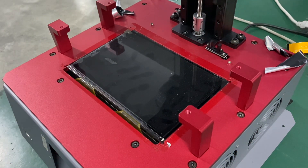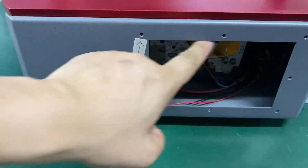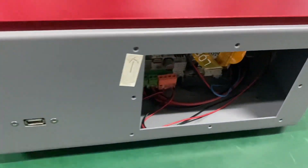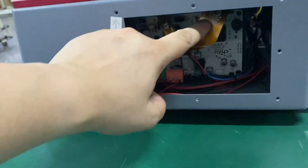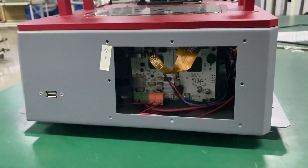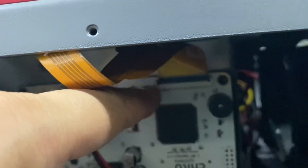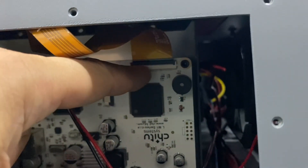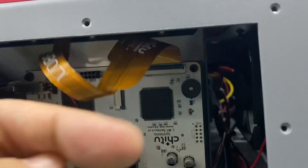Now you need to uncover the front window — the LCD touchscreen. You can see this cable; let me show you clearly. This is the LCD cable, which connects to a connector here. These are the flap connectors — the black one — you click to open it.